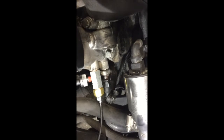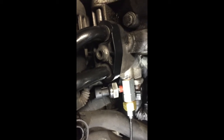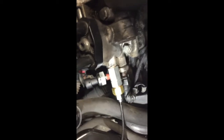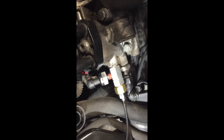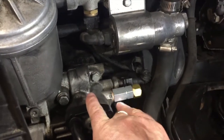Here I've got everything dry fit. You can see the OEM sensor relocated to the back, and I've got this extender I picked up from the UK. Everything is dry fit right now and it should be quite nice — hopefully it doesn't crank down too far. I've got temperature here and oil pressure here, so oil temperature and oil pressure coming off — looking good so far.